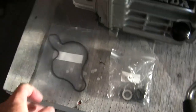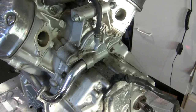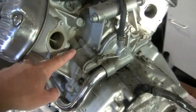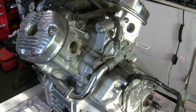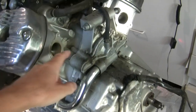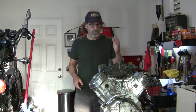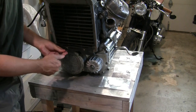I got a water pump seal for the water pump cover as well. The other thing I ordered — I should have ordered more than two because there are quite a few o-rings used here, in here, and in here. Let me get the dimensions on those o-rings in millimeters and I'll put them on the screen. There's more than one in the bike and I only ordered two, but there's probably one in there also, so get a bunch ahead of time. Since we're getting into the water pump, we'll have to drain the cooling system. The drain is under a plastic plate here, so I need to get these screws out.